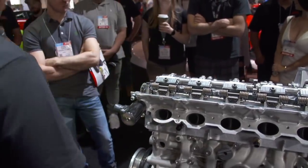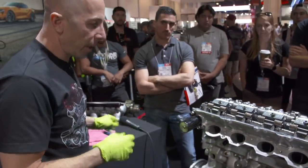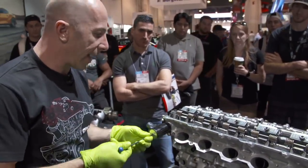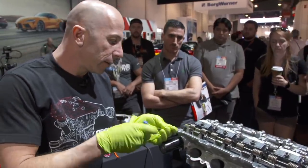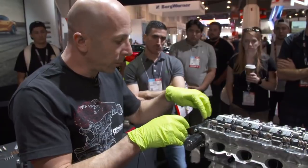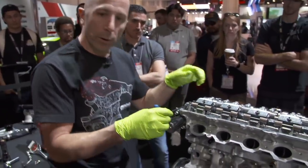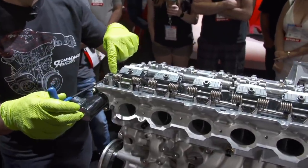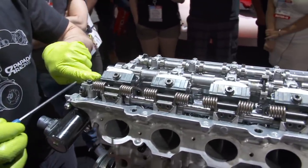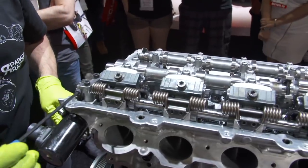This was a cool part, but you kind of need to have an idea of how you want to make it. So I sketched it out on paper and then built it in CAD and then made it out of 3D print plastic, and bolted it on to make sure everything was perfect, and then we made it out of steel. So the way this works is this pin goes all the way to maximum, and this bolt comes in and keeps it mechanically held at maximum.